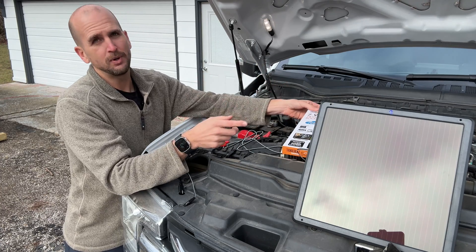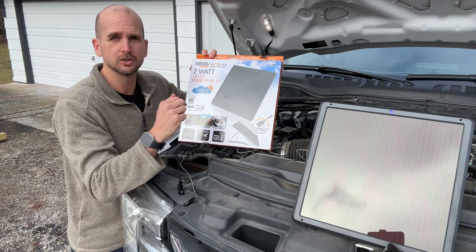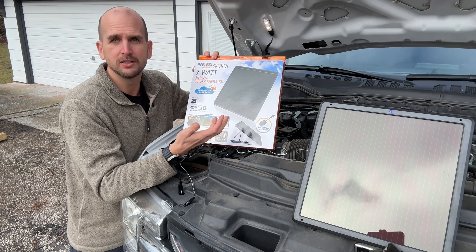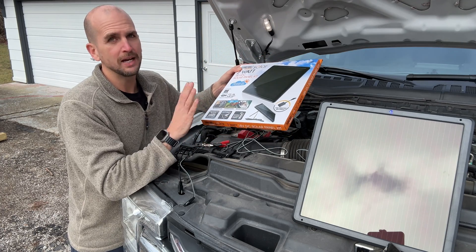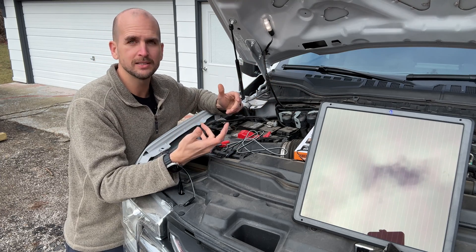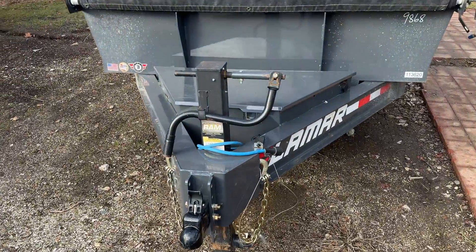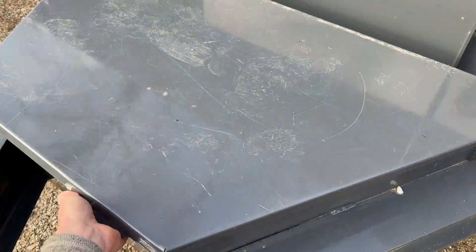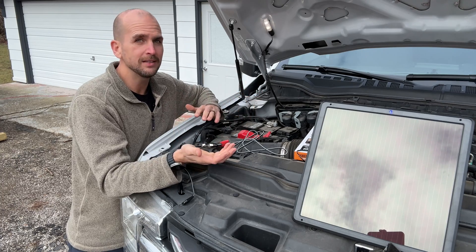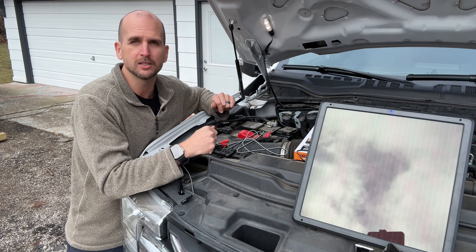In this scenario, the 7 watt panel — it's a Thunderbolt panel, and there are a few different types out there, with a link in the description to a similar one. These are actually made for charging or conditioning batteries. In this application they do not call for a charge controller between the battery, which is a very interesting concept. For instance, I have a dump trailer that I don't use very often, and it would be nice to have a small solar panel connected to that 12 volt battery to condition it, so when I need it there are no issues and it's ready to go.